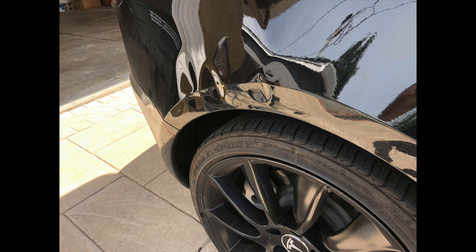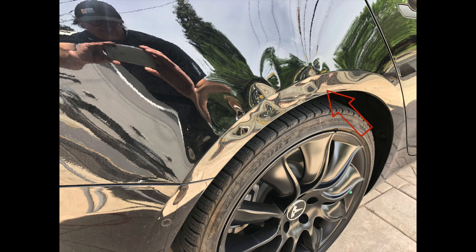You always bring confidence into these repairs from past repairs. You look at damage and say, okay, I've done that before — and it all just kind of adds up. In this case, the area that is always difficult and different each time is how it's creased along the edge right here. That is the seam where the outer layer and the inner layer are pressed together. So this particular curl right here, right next to the edge, that would be tough. And I wasn't quite sure how I was going to handle it. But from previous jobs, I picked up some tricks I was going to try on this one.